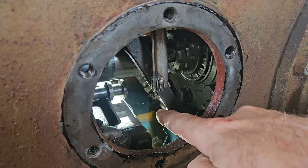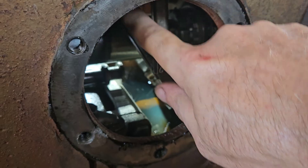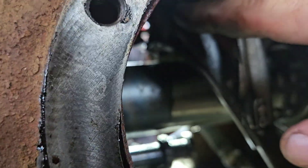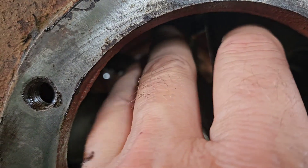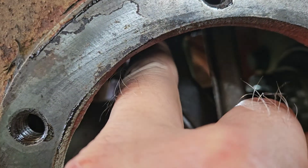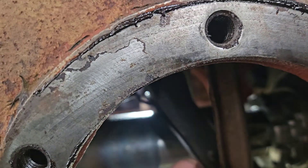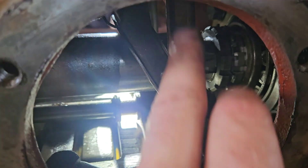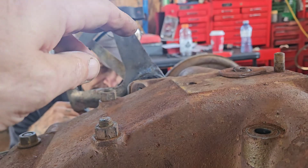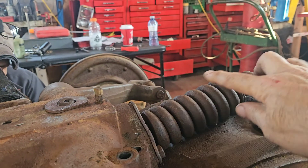As you can see, I'm going to point it out right here — this is our problem. This part of the linkage has a fang on it. Right there, I'm touching it with my finger. That fang is supposed to be on this side of the upper linkage. This is the lower half of the linkage, this is the upper half. This half goes up to the height control which is tied into the draft control — and this is broken, by the way, we've got to fix that.